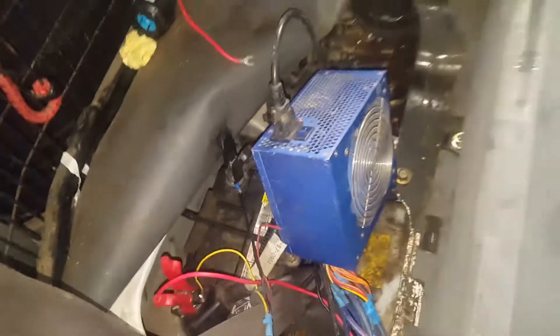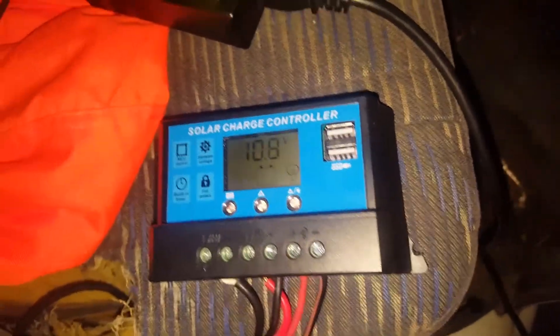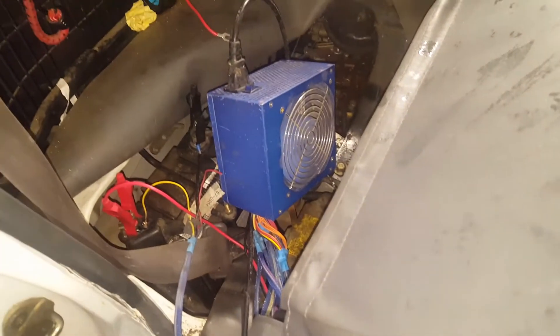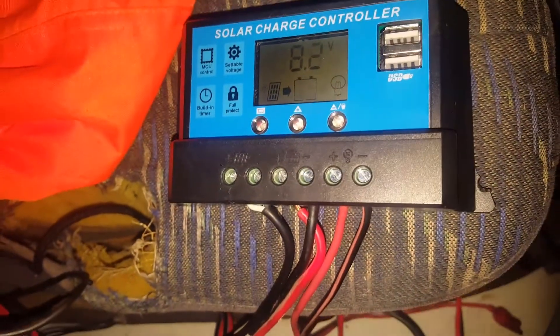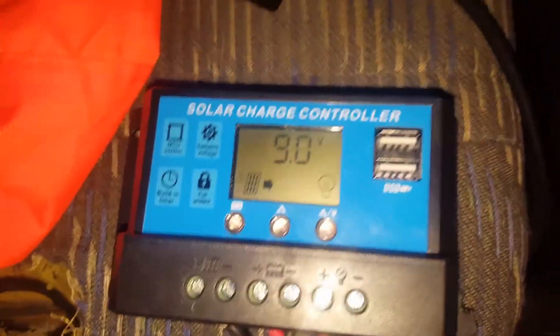I changed my mind — there was an ATX power supply closer. We'll just put the power supply on the terminals. It's got it to light up ever so faintly, and even though it's actually got enough power to run the headlights, we'll give that a minute. There's an interior light on in the back there. I'm going to unplug the ATX and see if we still got a voltage on the supply. Dropping fast — eight volts. Got it plugged in in time. Before it actually stopped, you can see it pulsing right there, and that's pulsing and charging off a laptop power supply.